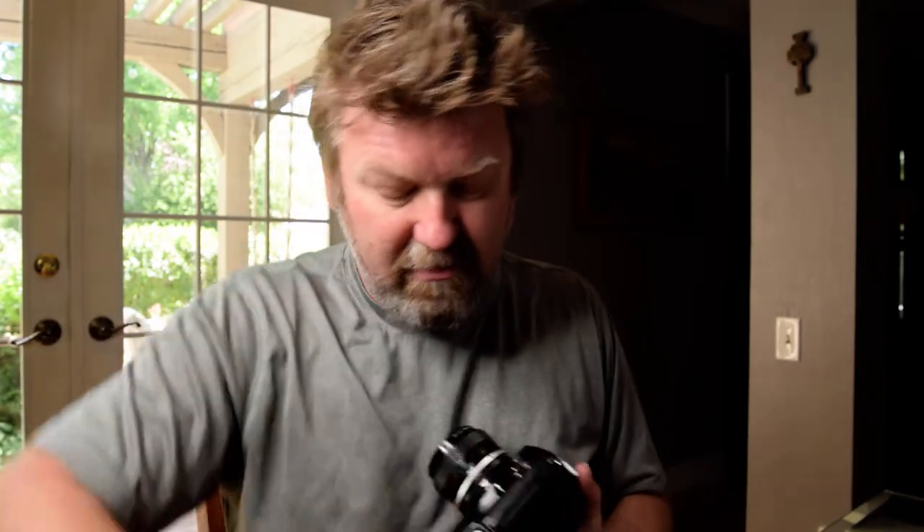For the motor drive, battery design — AA battery design — has changed ever so slightly over the years. Here are the rechargeables I use most of the time. That head was not enough to peek through the hole in this piece of plastic. That is the only problem I think this person had when they were trying to test it — they were using batteries that did not work in this cradle. This Energizer rechargeable battery has a slightly longer head and completely just makes this work. That is all that was wrong with the motor drive.